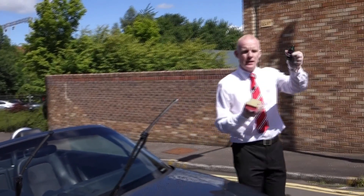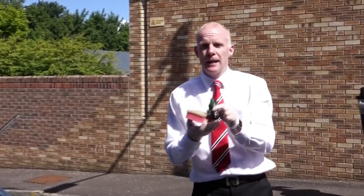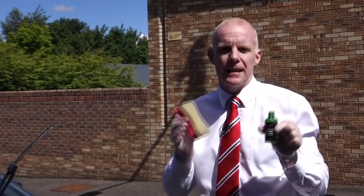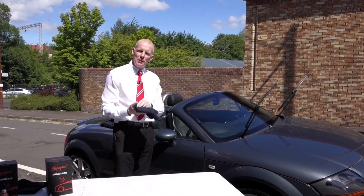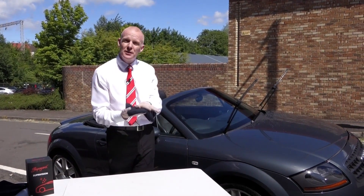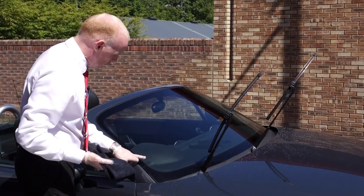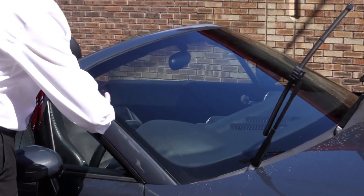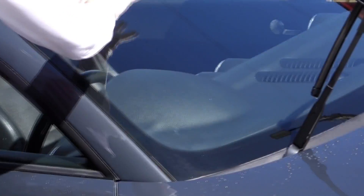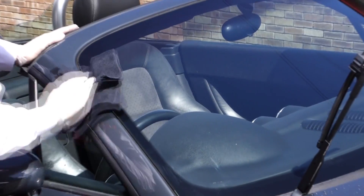What we do expect to see is that the bottle itself is actually empty — it's very important that you apply the entire content of the bottle right onto the windscreen to give it the best professional coating, and leave for five minutes. After five minutes, when the product has dried in, take your last microfibre cloth. We recommend folding it into a square and simply wiping off the excess. If you look closely at the windscreen you can actually see a kind of fading effect where the product has been applied to the surface.